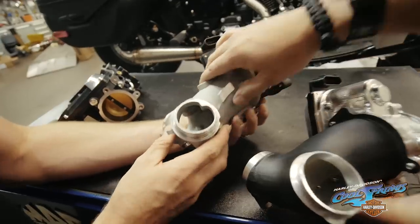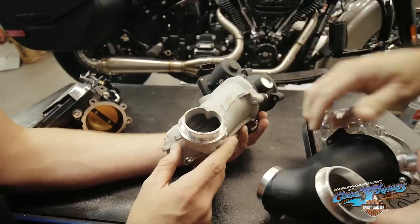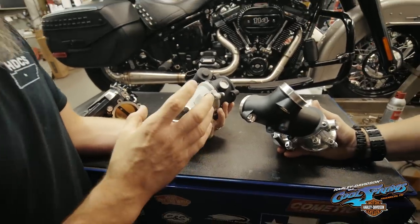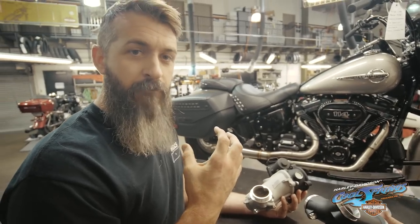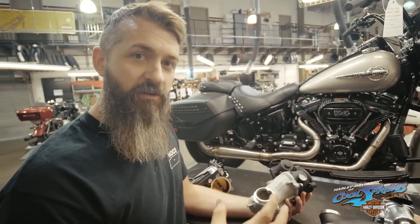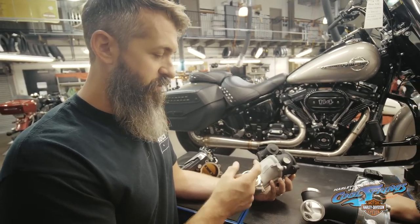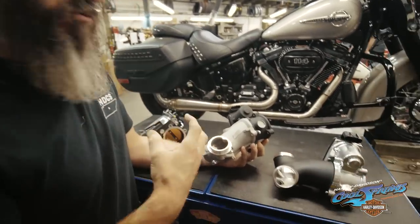The plenum where this guy breathes and where this guy breathes are two different plenums. This HPI plenum is a wider plenum with less of an angle — more of a straight line — than the CVO one or the Screaming Eagle. You can also see the casting on the Stage 4: there's a big ridge in here that just blocks flow. HPI has some testing on why Harley has that in there with their Stage 4 head, their cam, their exact setup — that ridge serves a purpose. But when you alter their package, alter their cam, alter the airflow, and you're not exactly how Harley designed it, this ridge gets in the way of the airflow. For what they're trying to do with their package, their head, and their cam design, it's said to help out the flow and keep the air from swirling inside the cylinder because it is a tight bend in there.